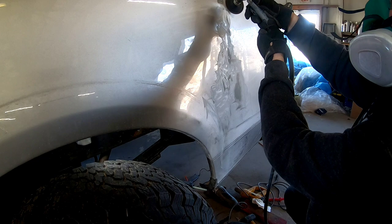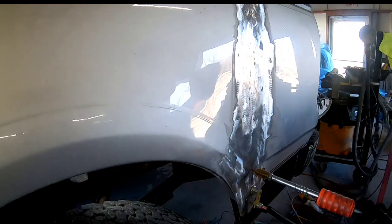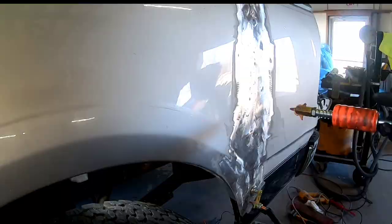Now I've got this bedside pushed out as much as I can with the port-a-power. We're going to switch tactics — we're going to grind it down to bare metal and then use a long dent tool to push out that crease. I'm going to switch over to the G90E and pull out some of these smaller dents, fine-tune those, tap down any high areas, and then switch over to the big PDR bar and do some major pushing on that crease.